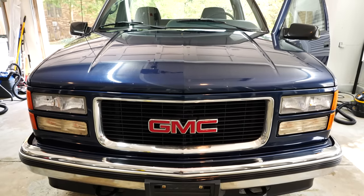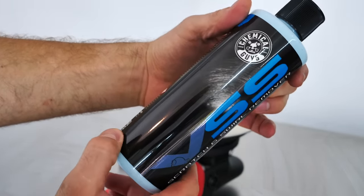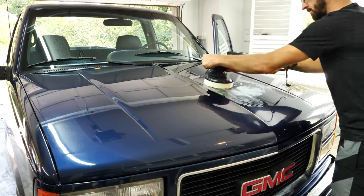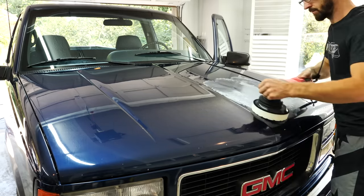Now with the car all cleaned up and under the fluorescent lights, you can see the level of oxidation on the surface — there are swirl marks, light scratching, and oxidation to the clear coat. That's all going to get completely cleaned up with Chemical Guys VSS. I like to use this first because it's a great scratch and swirl remover and a good one-step polish. You can do one to two passes with a medium pad and knock out probably 95% of the scratches, swirls, or oxidation for this specific car.